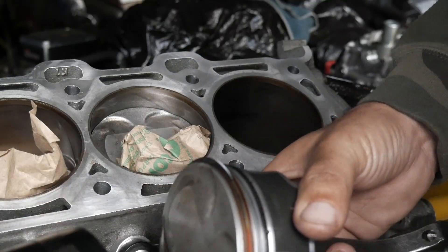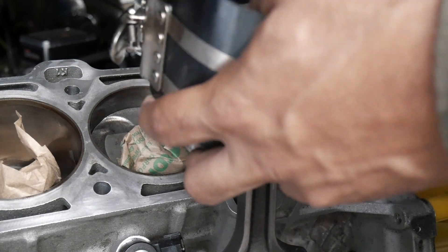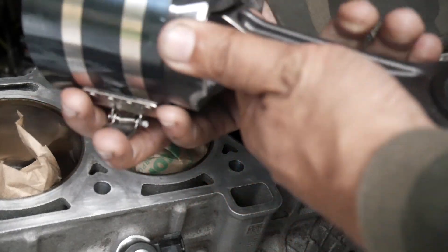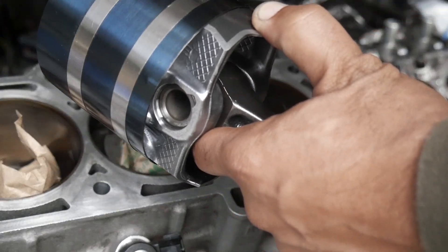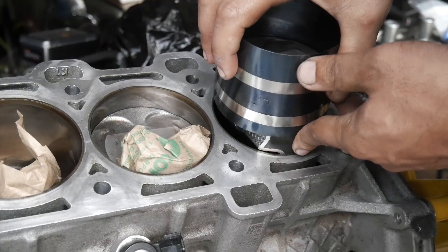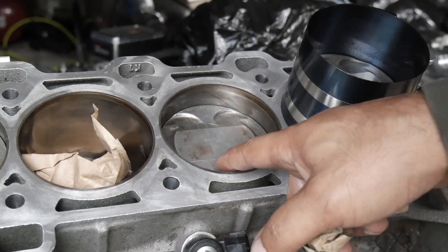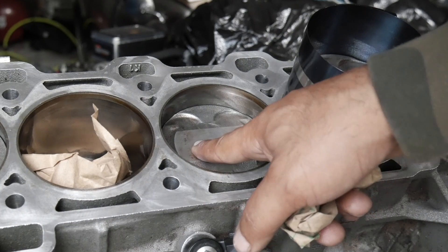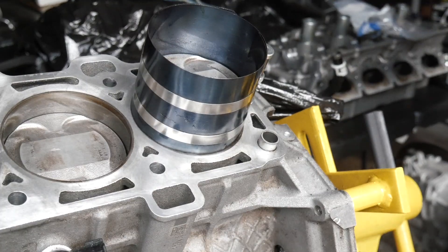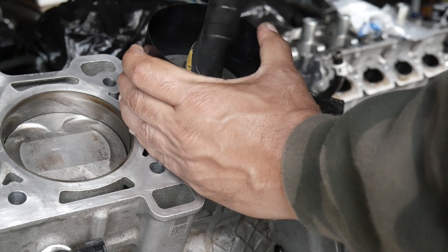You've got to make sure you really have it tight on the piston. As I put my piston in here, I'm making sure everything is lined up the way I want it to be. I'm going to make sure that the Allen key is facing towards the top so when I tighten it down everything's going to be good. I have this on here as tight as I can. I did make sure that I have part of the piston hanging out at the bottom. I also tried to make sure it was about as level as it could be, because if this is at an angle I'm worried that that may be how some of my piston rings slip out — because it's not compressed all the way around the way it needs to be. On the top of all of your pistons, at least the stock ones, there's a little arrow that points to the direction in which these need to face — all going forward. So what I'm going to do now is give this a little tap in here. You can use a tiny little rubber mallet; I've been using the rubber end of this hammer to just tap these on in.